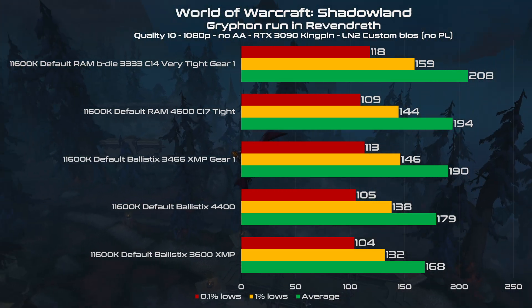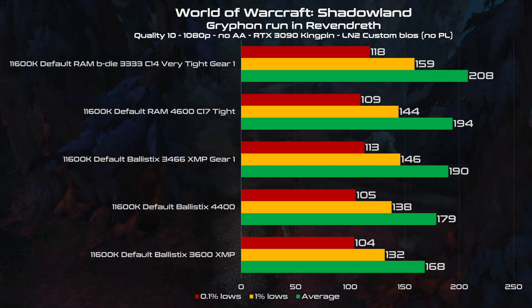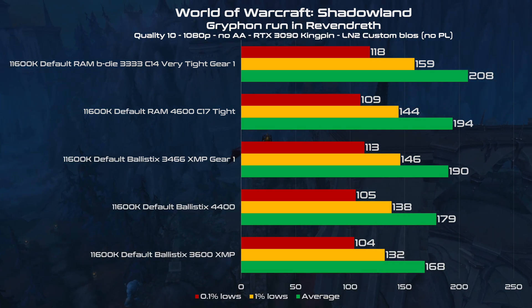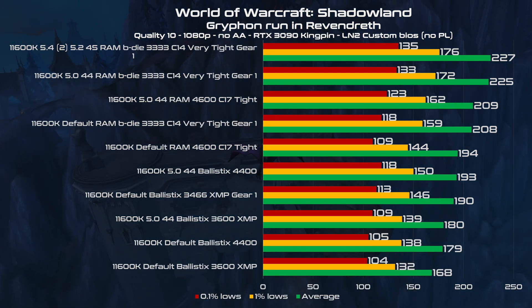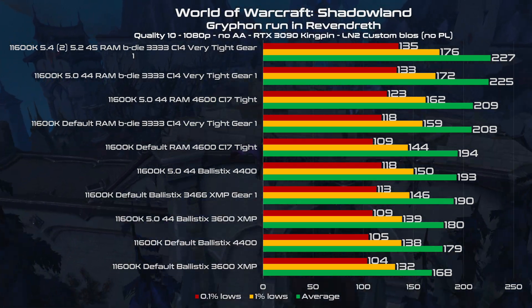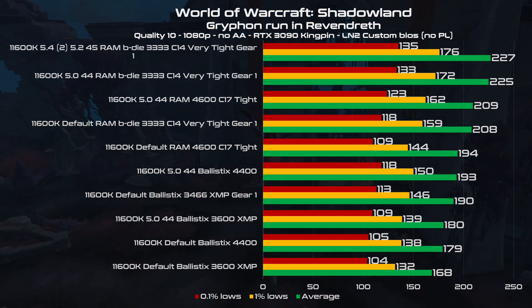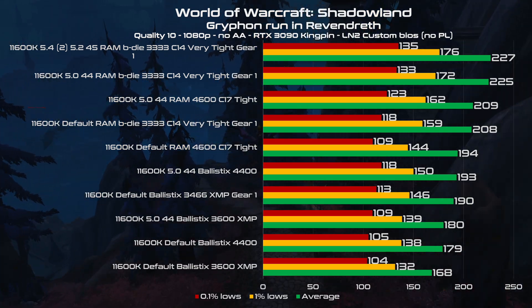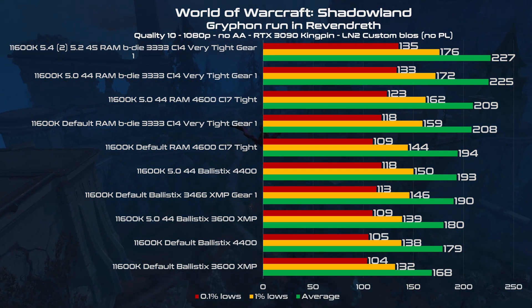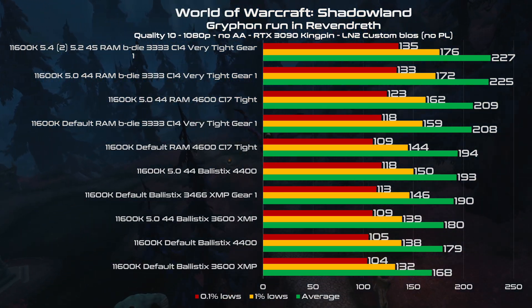A kit like the Viper Steel 4400 works well here. But there's a catch — like the fabric speed of Ryzen, it's not easy to reach speeds above the officially supported memory frequency. In my case, with a tight sub-timing setup, I hit a wall at 3333MHz. I was only able to use 3466MHz with an XMP profile that has loose sub-timings, so not very fast. If we take it a step further with CPU and ring overclocking, we get almost another 10% gain. I found it very easy to reach 5GHz and 44 ring just by changing the multipliers and applying a small offset to the V-core. I was also able to benchmark at 5.2 all-core with two cores at 5.4, but that used a voltage not safe for daily use, and World of Warcraft doesn't trigger the two-core boost — something I will test more in the future.